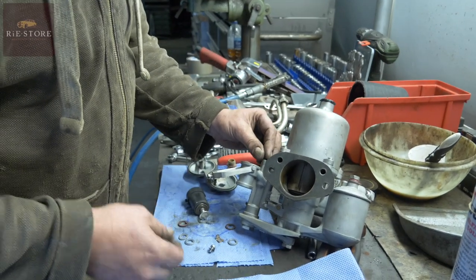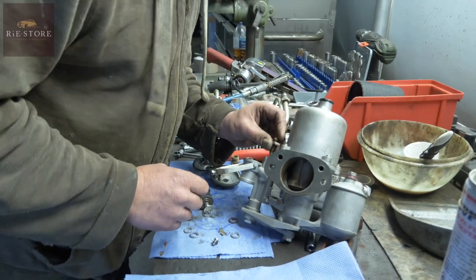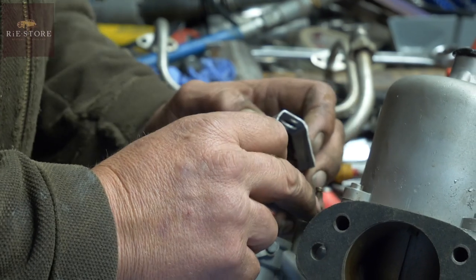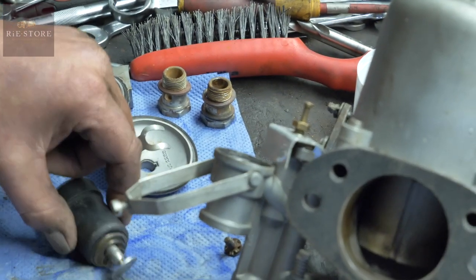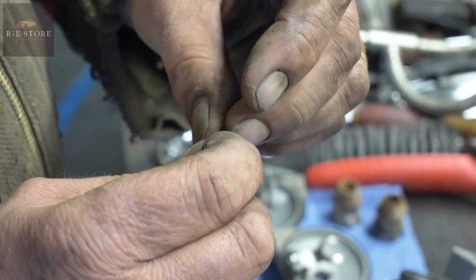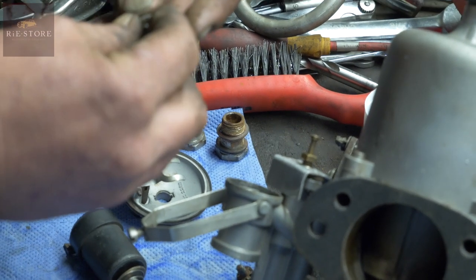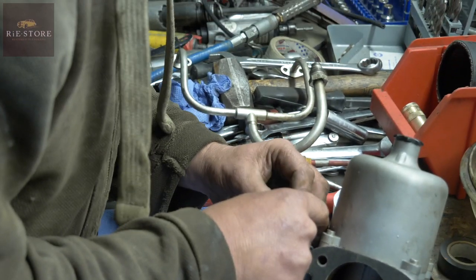Just put this back together. That's your choke guard - if it backfires, it stops the fuel blowing up through those and catching fire. You have to make sure this goes on because that stops it. You can adjust the automatic choke by that up and down for richness. You have to do that when the car's warm, and then short out the otter switch on the inlet manifold. Then you can set your mixture setting on it.